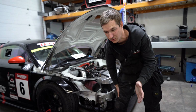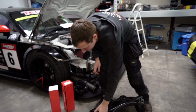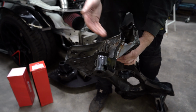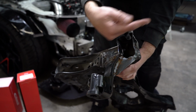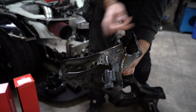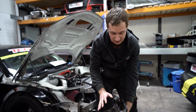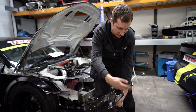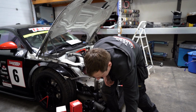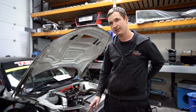If you look at underneath new Hyundais and stuff, it's ridiculous underneath. So as well, notching some bits out for clearance, chop this piece out so you can get the bolt in the other way, so you can actually take the bolt out without taking the gearbox out, which is a big thing when you're trying to change the bottom arms outside at tracks. It makes things hard. And we're changing the height just to get the roll centres in a bit of a better place. So that's that. That is a bit heavier because the one that's on there is aluminium, but it doesn't really matter.